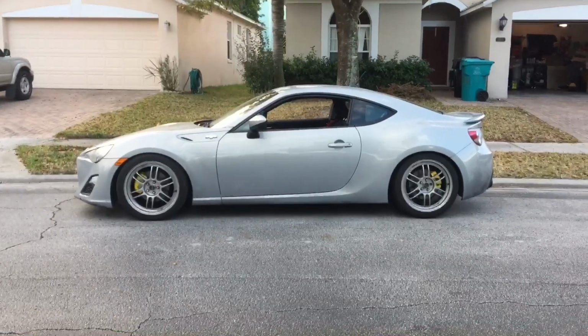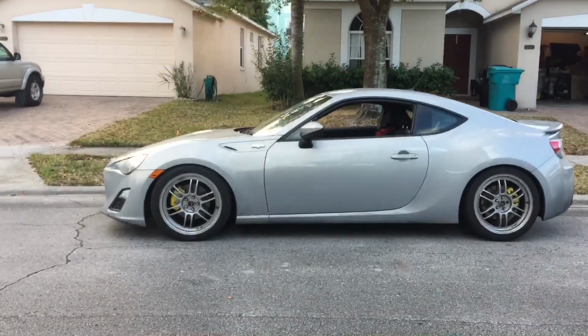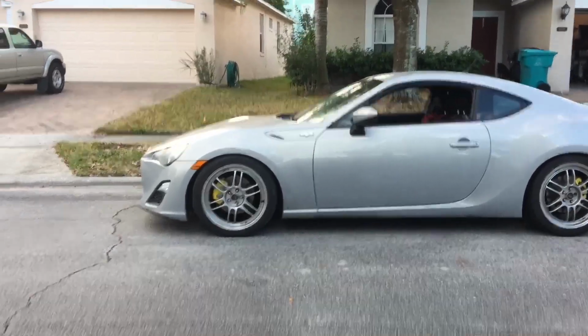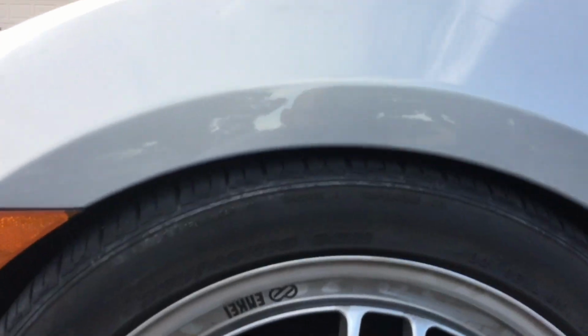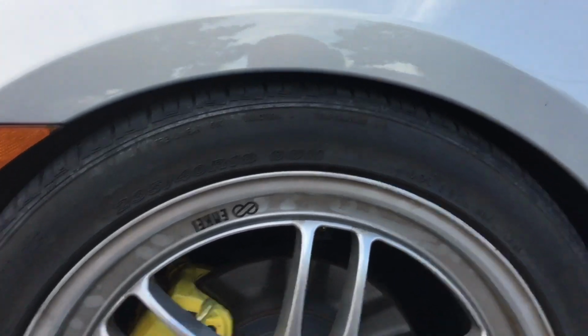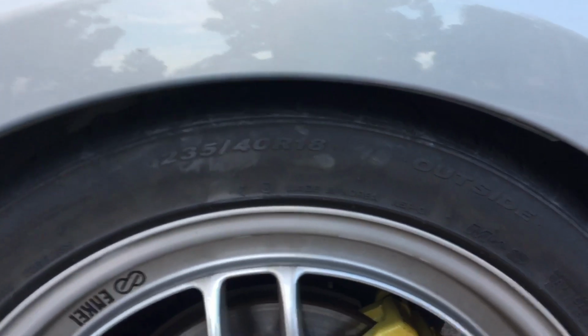So this is what we got at the first drop. Obviously, we need to drop the back a little bit. We need to drop the front just a hair. When I mean a hair, just a hair. If you notice, we're basically right there. So I want to say, bro, when I mean nothing, we're gonna just drop it by nothing in the front. And the back, we're gonna drop about a 1/4 inch, half an inch. That's all we're missing there. So, all right, let's throw it back in and adjust it again.